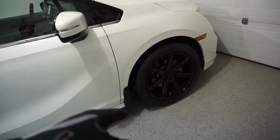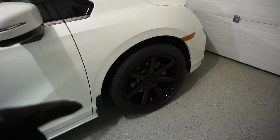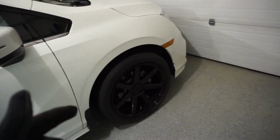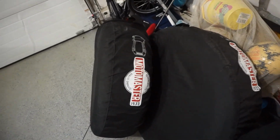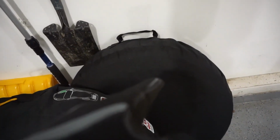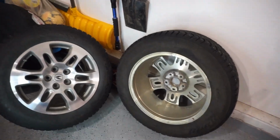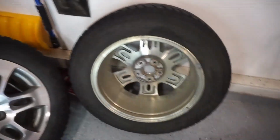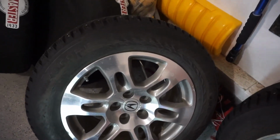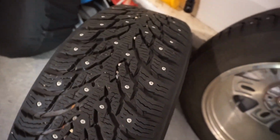So that's why you want to put the highest traction, the highest tread up front. And also, these are your steering tires. So, also a good thing. So I'm gonna take these bags off, and then I'll keep in mind front, rear, for now, until I measure the tread depth. Okay, these are my front and rear tire. I'm going to measure the tread depth to make sure that this indeed is my front tire.